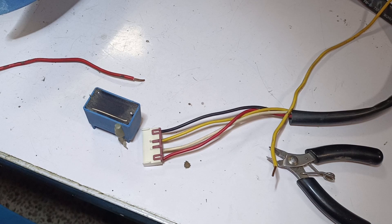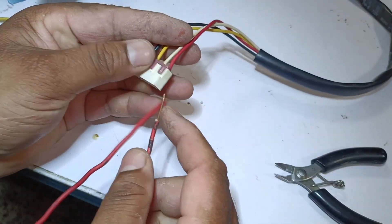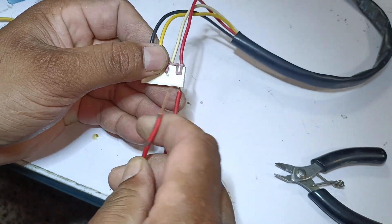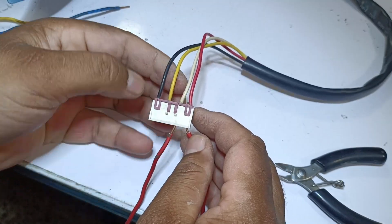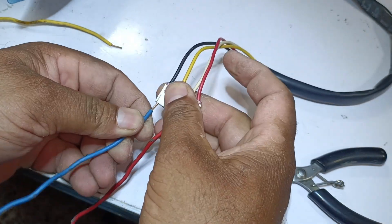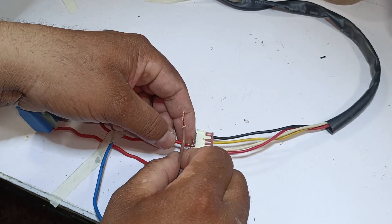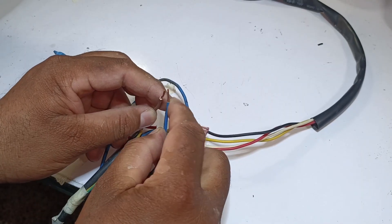Now I will proceed with the motor wiring. I will connect one capacitor wire to the connector's red wire. I'll connect the second wire of the capacitor to the white wire of the connector. These remaining two wires are for speed control. I'll test the motor at one of the speeds, starting with the black wire. I've connected the blue wire to the speed wire. The neutral wire in the connector is white, so we'll attach it and connect the phase wire to the speed wire.